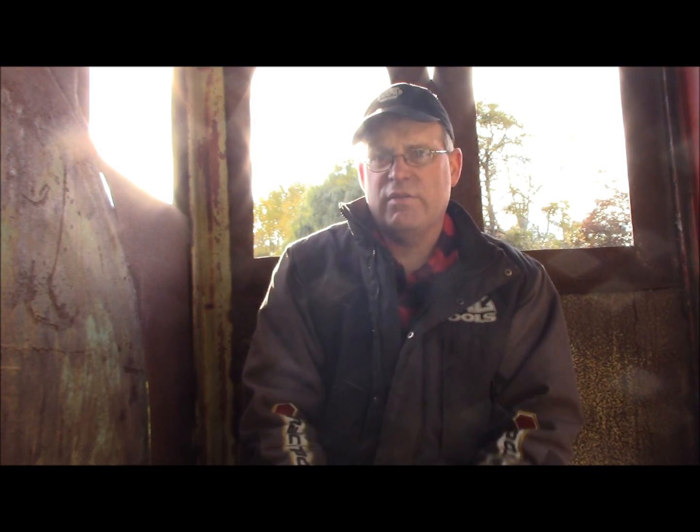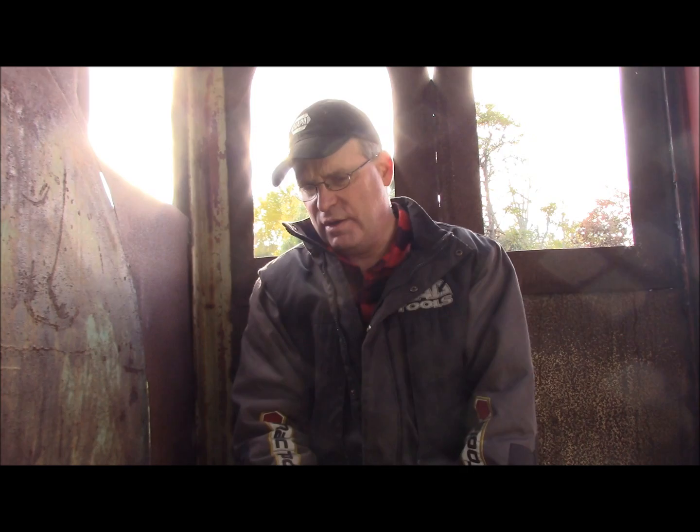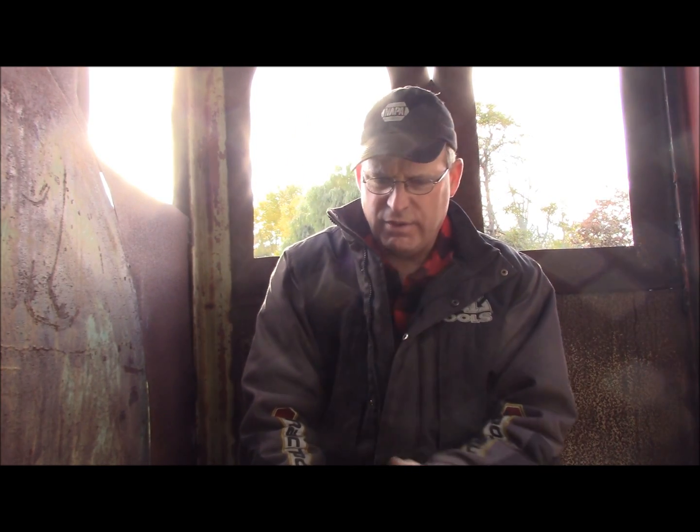It still needs a cross member put in there with a tranny mount. That's not hard at all, that part. The steering by far is going to be the hardest. The brakes will be easy to do. It may only stop on the front brakes. I don't know yet. We've got calipers and rotors up front, and the back is just drum brakes. So we could possibly make everything work. We'll see how far we get.